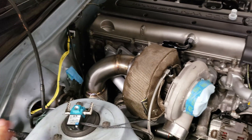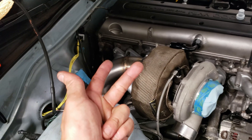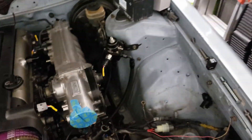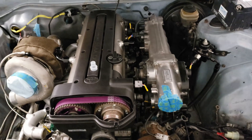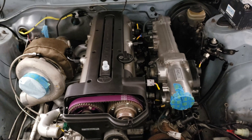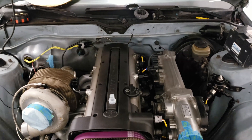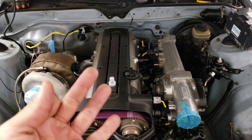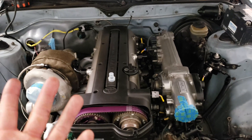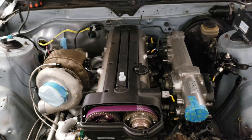ECU is powered up — switched and everything's hooked up. The only thing I don't have is the TPS sensor that I've been waiting on, so hopefully that comes in tomorrow and I can go for a start. Realistically I don't see what else is needed — fuel pump's good. Oh, I still need to do grounds. I need to ground the head, the intake manifold, the block, and the transmission.